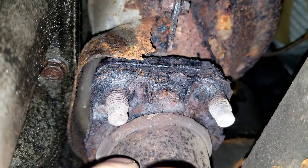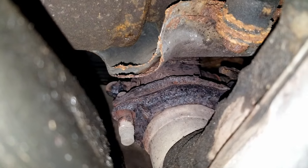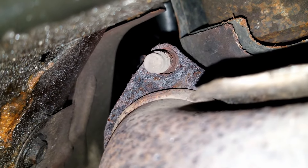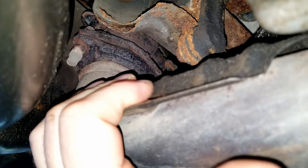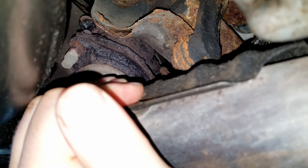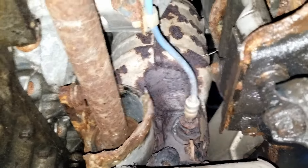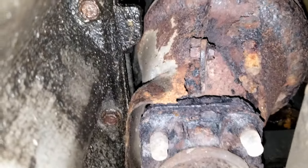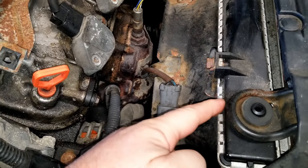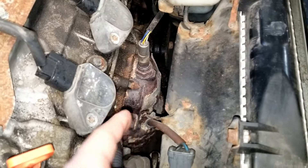Following around to the other side, there's no nuts there either — or there were, and they're just crumbling. Not really sure how this exhaust is hanging on, but don't worry — the back is worse. That nut's all gone, and you can even see light through it, like there's a big hole there. The proper way to get the rear cat out, you gotta take the exhaust down, take the half shaft out, and then the little cat will unbolt from the head and slide down the bottom. The front cat has to come out the top after draining the coolant and pulling the radiator.